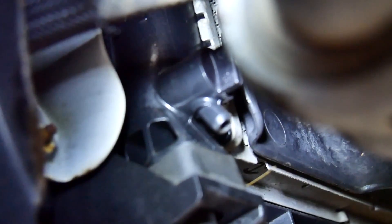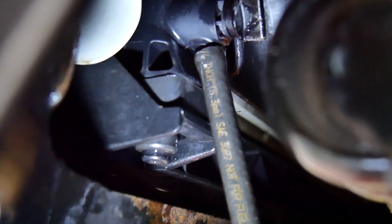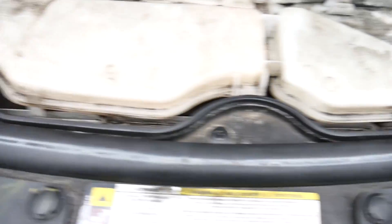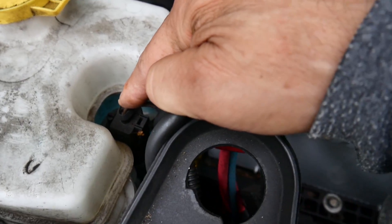So the first thing we have to do is drain the coolant out of the bottom of the radiator. I was able to put a small hose on there to direct it into a little basin. That valve wasn't that easy to open — it was kind of tight and there's not a lot of room to get in there and turn it. While that's still draining, I'm going to take off this little hose, take off that screw, and take off this wire harness here — I think this is for the windshield washer sprayer.